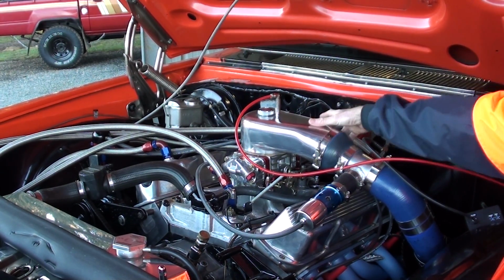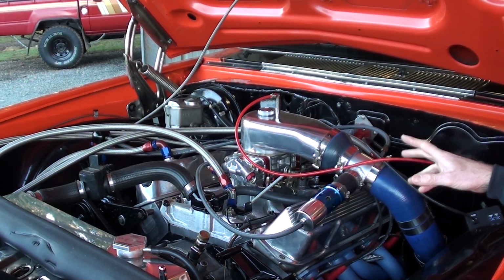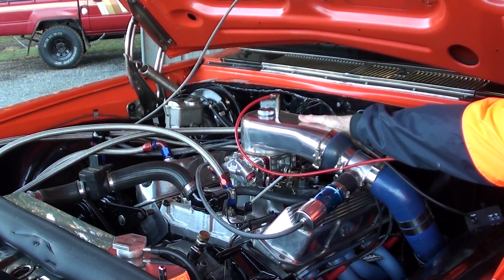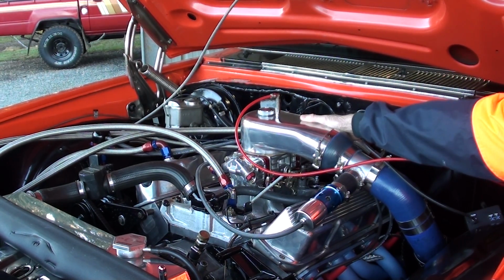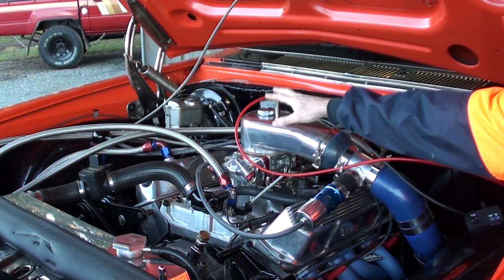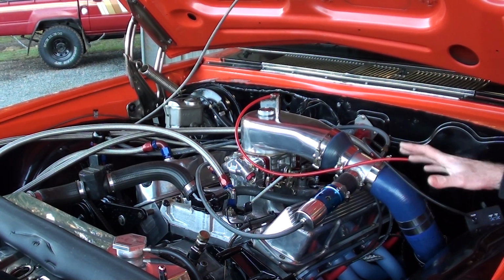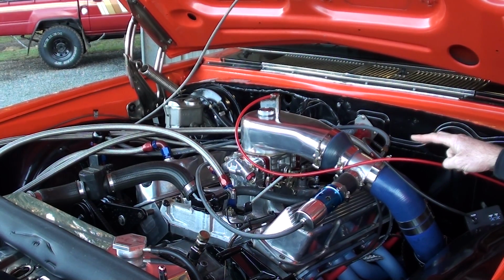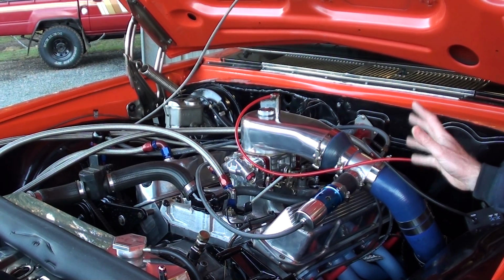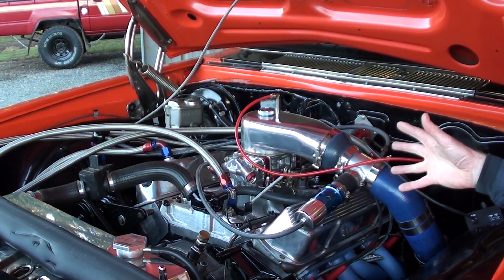Of course you can play around with jetting. I've only gone a couple of sizes on the rear over standard, and even then I feel I could probably come back a couple of sizes. It wouldn't hurt, and I may do once I get settled in with the water meth. But as far as consistency goes, it's unbelievable. It really is. It only really hovers when it's wide open throttle under full load. It only goes from 1 to 2, so it hovers around 11.5 to 11.7.